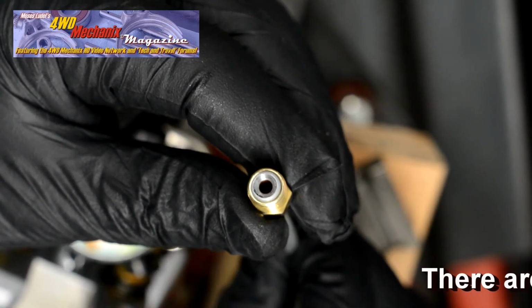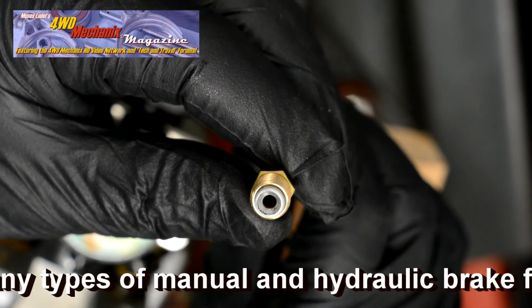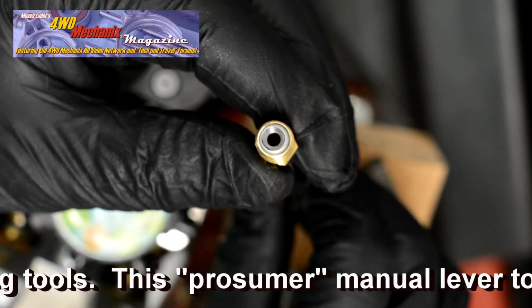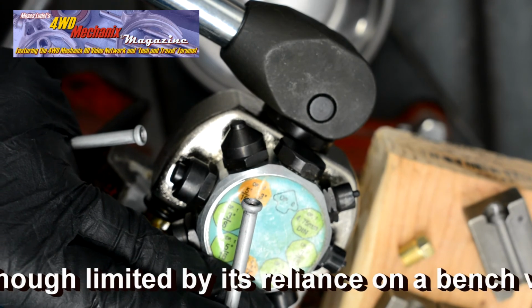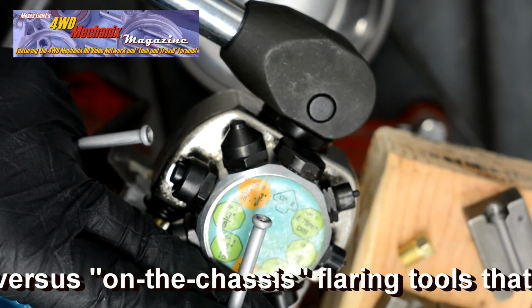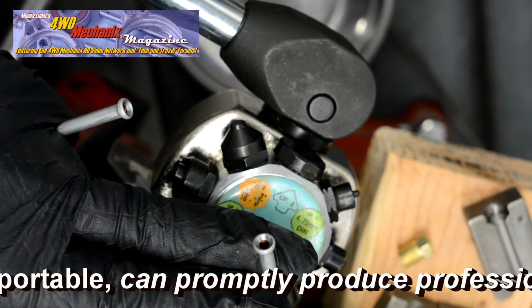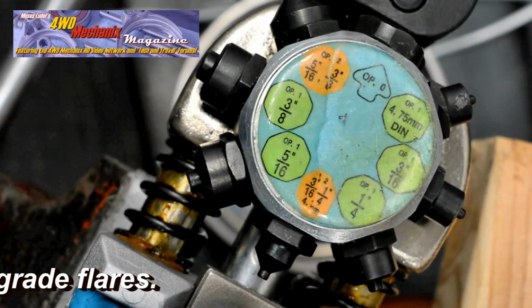That involves torquing the nut to factory specification to make the inverted 45-degree flare seal tightly against the flare seat of the cylinder or fittings. Considering the professional finish, the elimination of marring above the flare, and general appearance of the flare, this is the biggest bang for the buck in prosumer level brake flare tools.